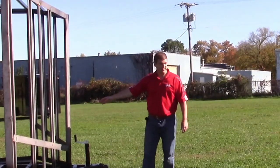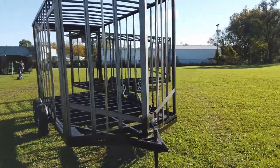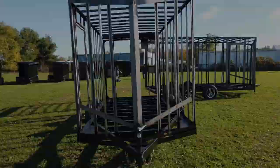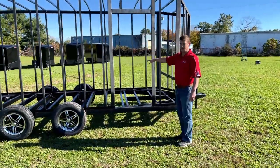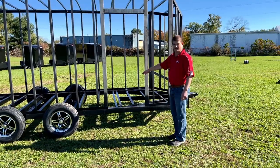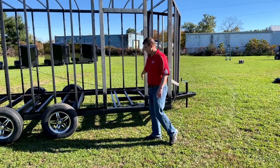If you look at the tube framing here, we have a four inch frame, 16 on centers all the way around. Over here we have the RV door opening — 32 inches wide, 72 inches tall. Every WJ trailer will have a 400 series RV door, and this is the opening for it.